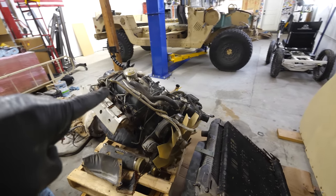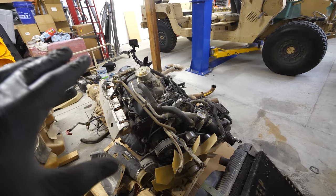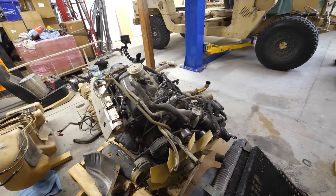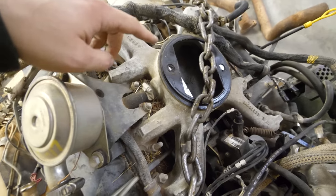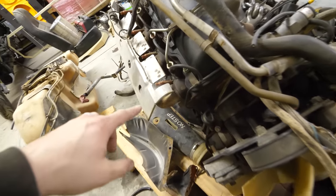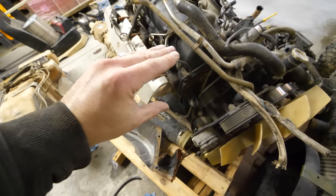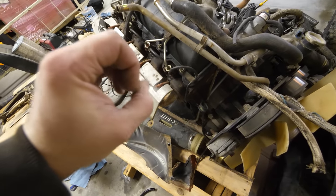Now this beast is a super complex, finely tuned machine that requires a lot of different things in order to function, and since it's not functioning right now, it's super hard to get all those things dialed in. But basically, there needs to be explosions inside in order to propel the Humvee forward. You can see that as it's sucking in the air, it goes into a bunch of different chambers, and each of those chambers has these little glow plugs right here. So as the pistons compress the air and these dinosaur droplets together, they explode.